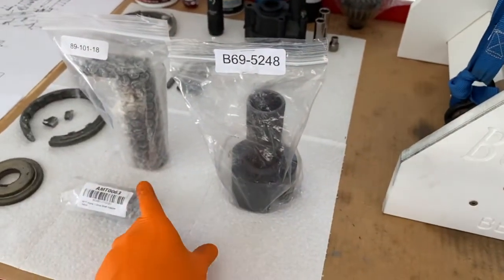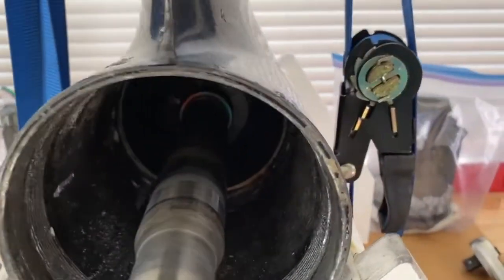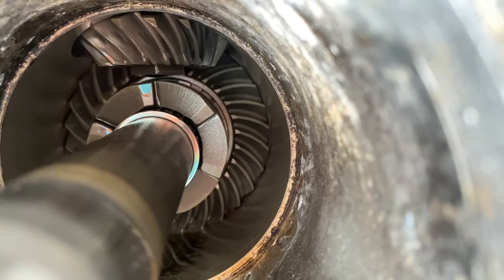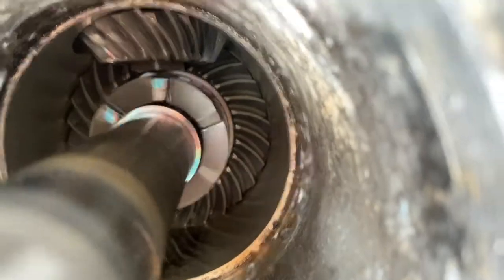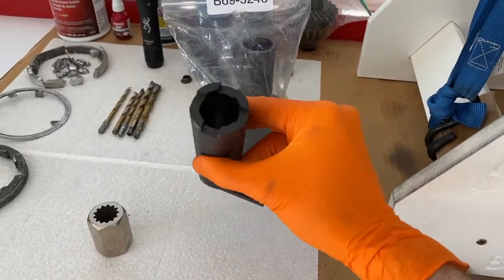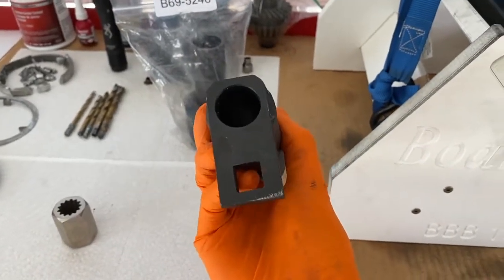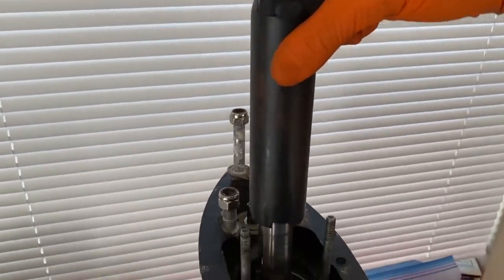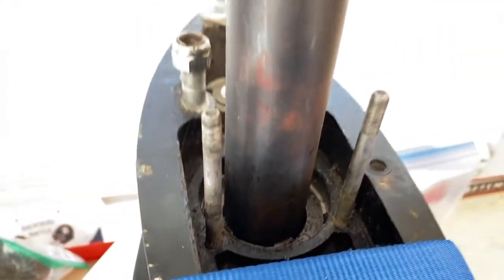Next, we need to open some parts — we're going to open the adapter nut and retainer wrench. I've got the parts unpackaged. Inside the lower case, you can see the upper pinion gear and nut, the propeller shaft feeding through the clutch dog, and that gear. As I spin this, nothing's moving — it is now safe to continue. We'll grab the retainer wrench; it's got a half-inch connection for a ratchet. We are going to carefully slide it over the driveshaft and all the way down to the retainer nut and align it properly.